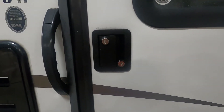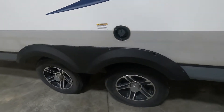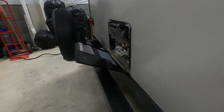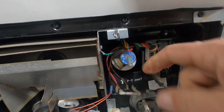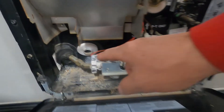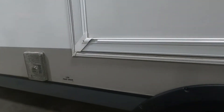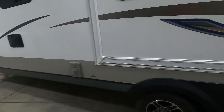Lock and deadbolt your door, then go around and bring up your stabilizing jacks. Bring your steps up. Come to the hot water heater — unhook your water first, unhook your cable, then lift up on the pressure release valve and leave that up to drain your hot water out. Once that's done, remember to close it or your panel won't close, and then you can pull this drain down. Don't forget to close your hot water heater door. Put the plug back in, then open your low-point drains — do this if hooked up to potable water or city water. Come down and empty the low-point drain if you're dry camping. Then hook up your hitch and head out to the dump station.